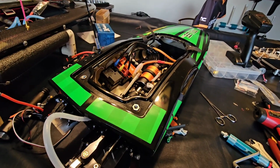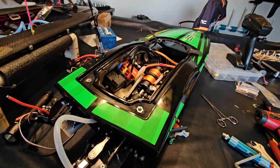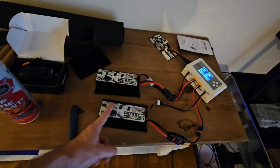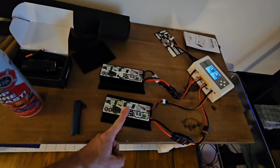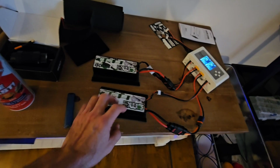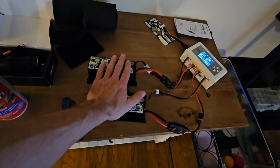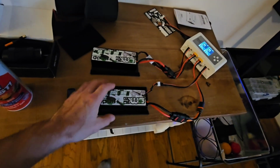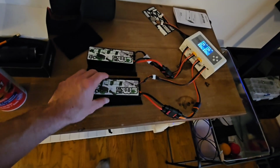One thing is, and I wasn't very excited about it, when I pulled my batteries out, one of my batteries was fine. It was like 3.6, 3.5, 3.6. The other battery was 3.5, 3.25, and then 3.14. These are the very first time I've ever ran these batteries. They won't fit in anything else, and I haven't ran the Spartan. They were originally bought for the Dominator, but they wouldn't fit. So I was like, okay, these would be perfect. Let's go ahead and give these a cycle.